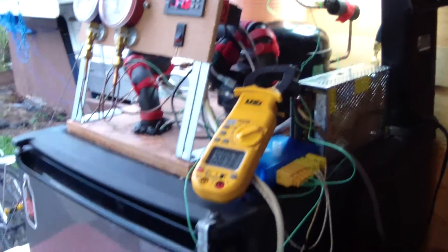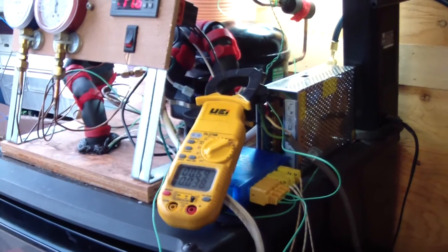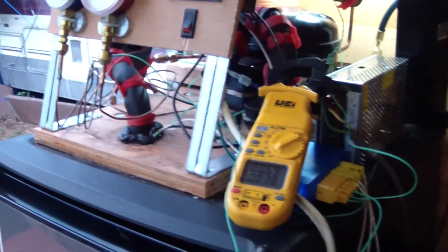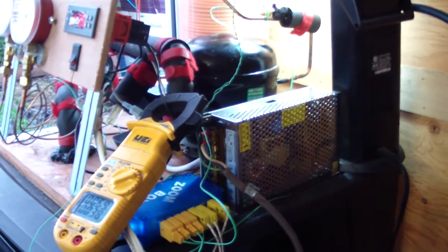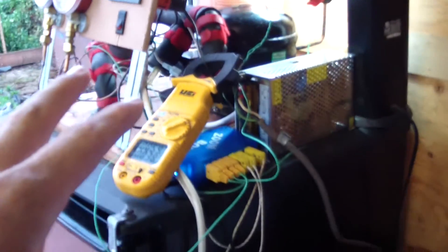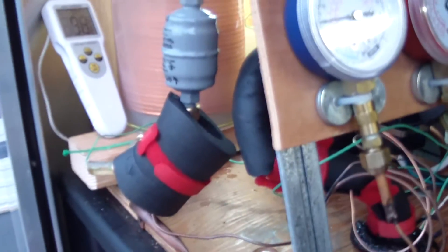This increases both run time length and off time length significantly. Typically over the last few days it runs for about an hour and is off for about four or five hours. The compressor is a rotary compressor, 120V AC, about one-eighth horsepower. The refrigerant is propane straight out of the bottle — barbecue grade, also known as R290 when it's a bit more refined.